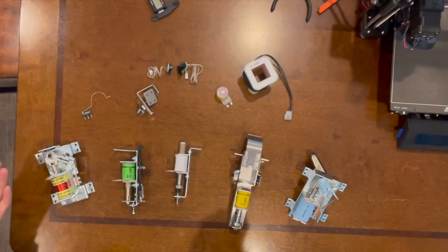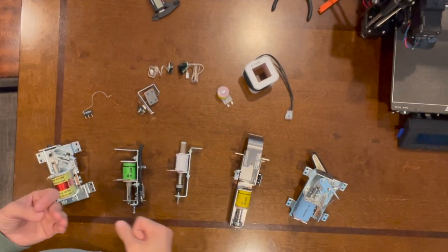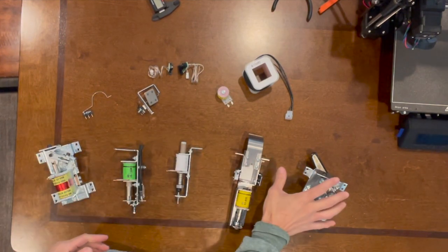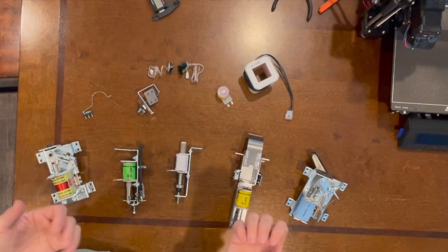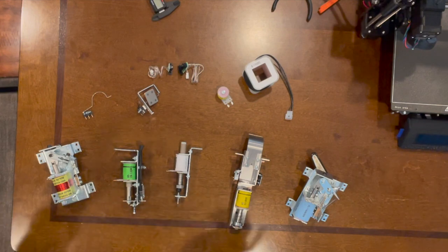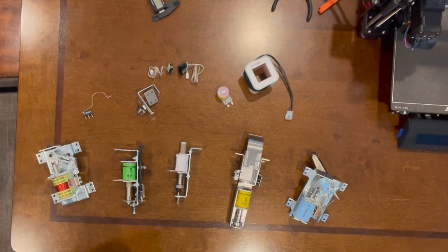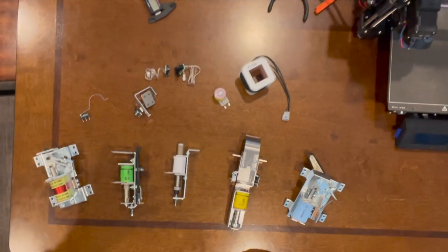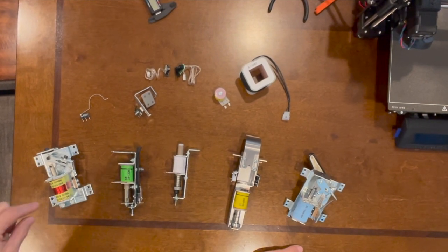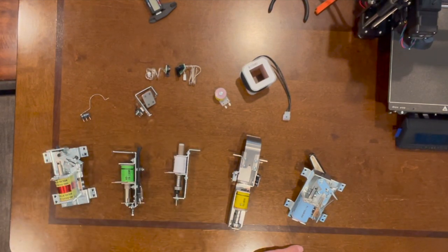So really, at the end of the day, pinball machines are just a big collection of very, very simple machines — there's just a lot of them, and we've got to take the time to know where to put them, how to connect them, and make sure we have software. We've talked about the electrical side and some of the mechanical side. There's also going to be a lot of software we have to do. The good news is we don't have to build that software from scratch either — there are people who have created open source platforms. The one I'm using is called Mission Pinball Framework, or MPF. It works off a system of YAML config files; it's very simple to understand as long as you have some good instructions, and there are some good tutorials out there. I'll put a link in the description below for that coil chart in case you ever need to reference which coils are known for what power.